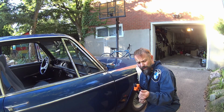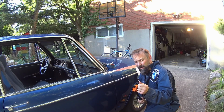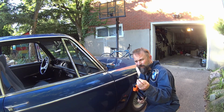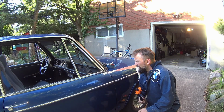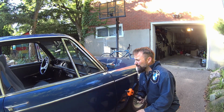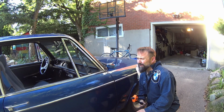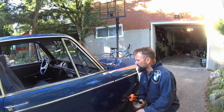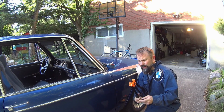So, seeing as I'm probably never going to use this 10-24, and I can probably buy this, I'm going to machine this down to an M4 by 0.7 and see if I can click it on. So I'm going to do that right now. If there's enough time, I will finish this off tonight, but it might be extended to a different day. So check your kit, make sure you got the right stuff.